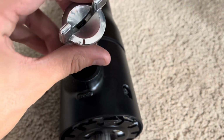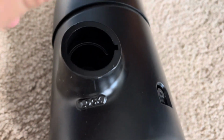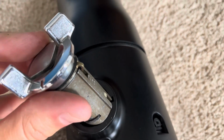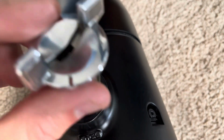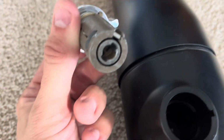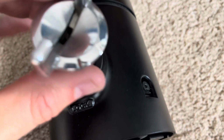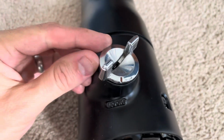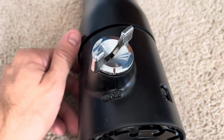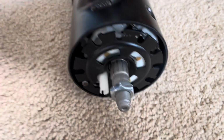Okay, on the install part, it's pretty plain and simple. You got the dash line here to line up with the lock. This cutout is really just this little notch here, this little gold piece. It's gonna go right in there like that. You can look down here, you got a tab, and that's gonna go right in the end of that lock cylinder. So it's pretty cut and dry, and that's just gonna drop in, and piece of cake after that. So it just slid right in, and then that last little quarter of an inch just snap. It pops right in and locks where that spring was that we took out. So luckily it's already preloaded. I don't have to do any of this part, but that was it.